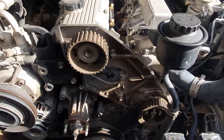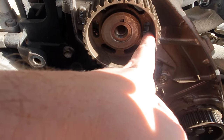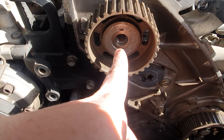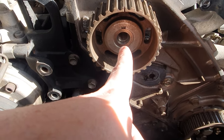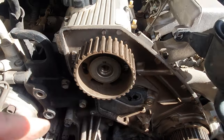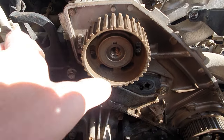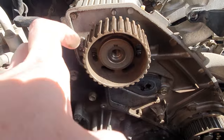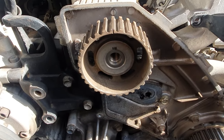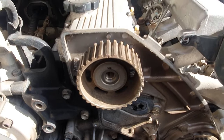Then remove your belt. You need to put a screwdriver in here on this side, and with an impact gun and a 19mm impact socket you will lock it in place so it doesn't move and back the bolt out. If the bolt doesn't want to come out and it rotates backwards, just rotate it backwards then forwards again to line the mark up prior to putting it all back together — that way you're taking up any slack in the valve train and won't cause any engine damage.